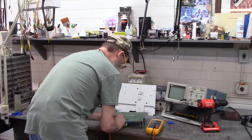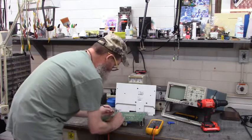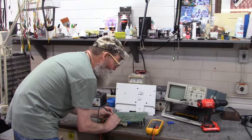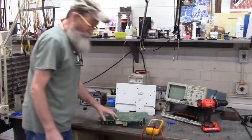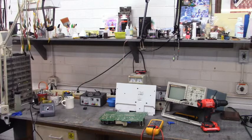Look at that - we'll get closer. I've got zero ohms of contact resistance across those two contacts. And zero ohms here. The contacts in both those pre-charge relays have welded themselves together. We're going to have to replace those.